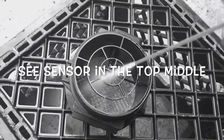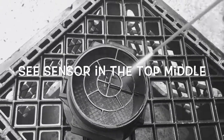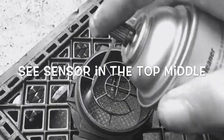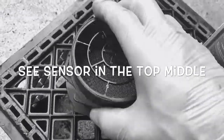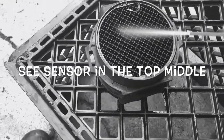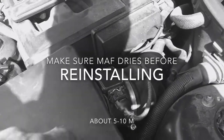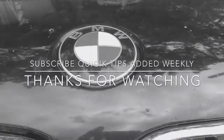Just spray it — the stuff evaporates, so it won't drip to the floor, and it's safe for the sensors, so you have nothing to worry about. Make sure you get it nice and thorough. Now turn it around and do the next side. Then reverse the procedure, reinstall the mass air flow sensor, make sure you put the connector back on, and tighten up the clamp. Thanks for watching!